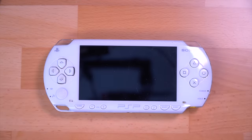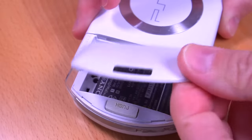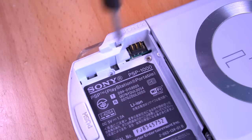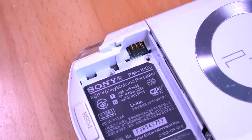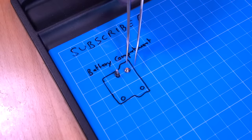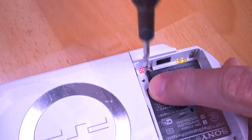To get started we need to first pretty much tear down the entire PSP. One thing that's absolutely critical is organization, because the PSP has quite an assortment of different screws of varying sizes, and remembering where they go when reassembling is critical — otherwise you could damage the shell or console. To help with this I recommend getting a magnetic board like this one from iFixit. I've been using these long before they sponsored the channel and it's an invaluable tool for keeping all your screws secured and organized.